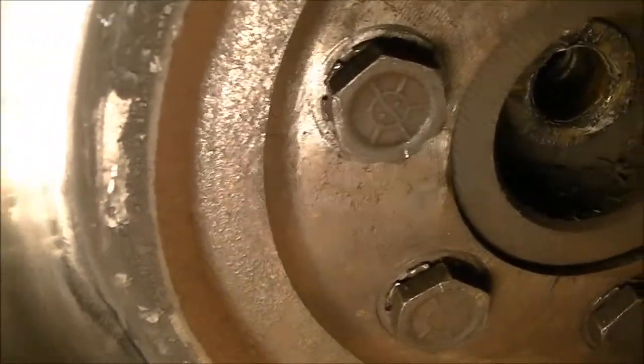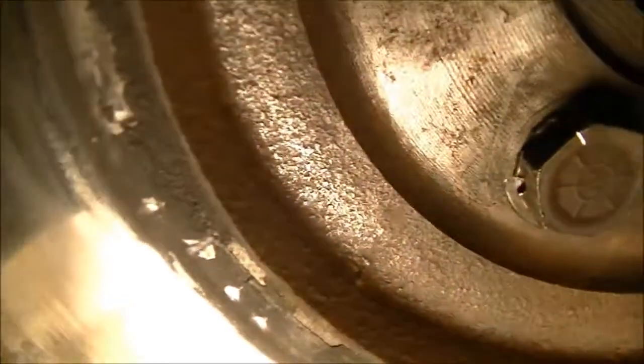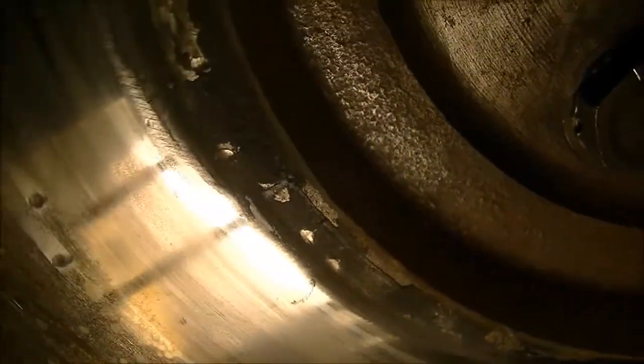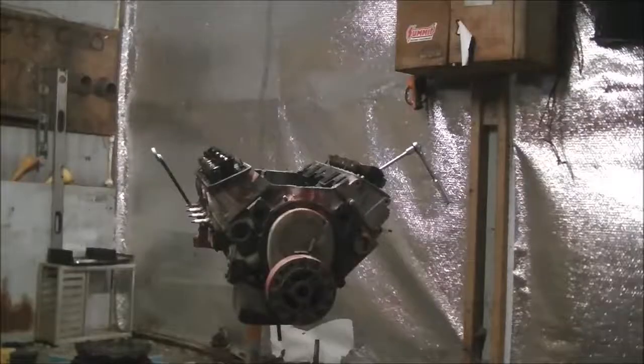Also, the engagement - it's trying to engage the clutch on this burnt-up, rusty crap. The clutch wants to engage almost to that line right there, you see. So that might be part of the reason why it's not disengaging - it's trying to chew through all that mess and it is wearing the center of the clutch out. But here's a problem I see right off the bat.